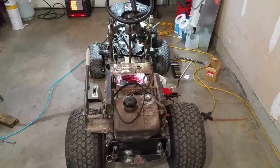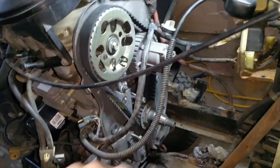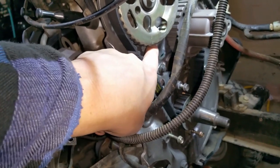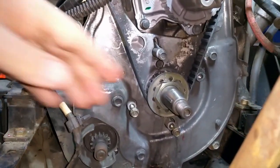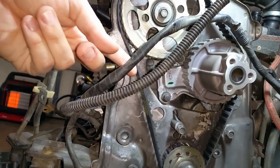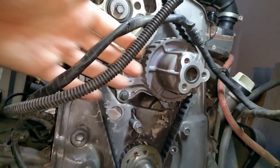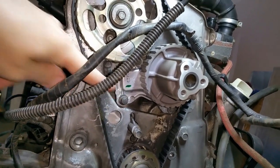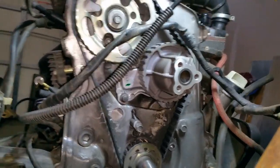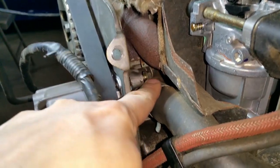Here we are working on the 3813 — we got the machine stripped down, the charging coils removed, and we are currently replacing the timing belt and the water pump. These are the new parts. I did notice the timing marks: there is an F for fire and T for time, and there is a little timing mark below here and also here on the crankshaft. I saw that it had jumped a tooth on the old timing belt — I don't know if it stretched out or not, but we were able to get that corrected. This is the new water pump. We'll push this across, get it tightened up, and these get torqued down to 7.5 foot-pounds. There's one here, two, three underneath, and then the hidden one is on the other side — it's a 10mm and far easier to access than on the 45-14.